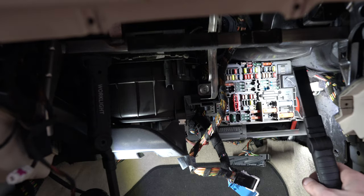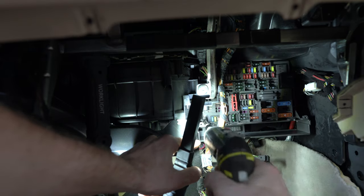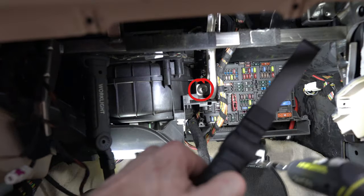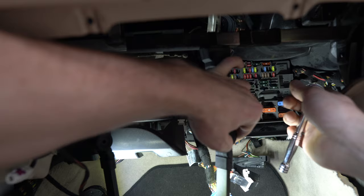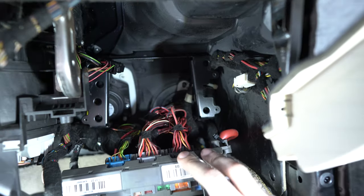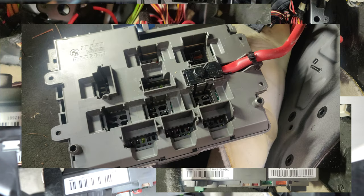I'll still remove the junction box to confirm there's no corrosion. There are four T20 screws holding the shell — two hidden on the right side and two on the left. To reach one of them it's easier to remove the screw from the AC bracket, which gives more room to get to the one hiding behind the wire. Take your time removing them. Then remove all of the clamps at the back of the fuse box using a pin tool to get to the securing pin and remove them one by one.